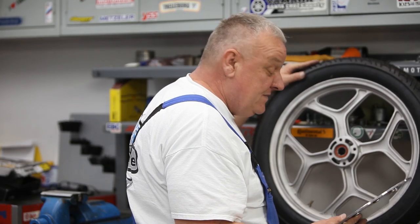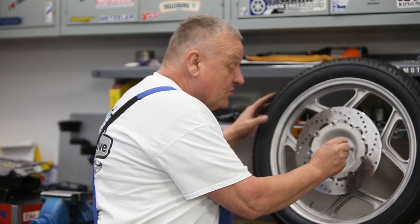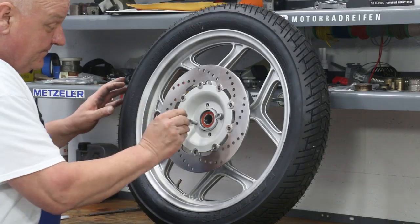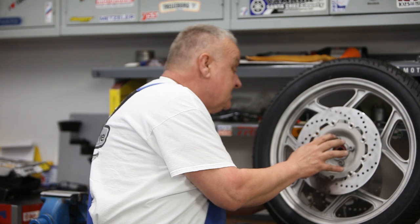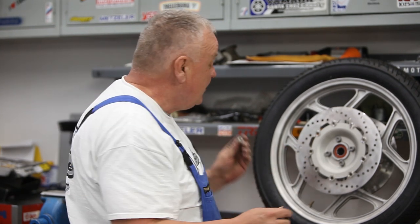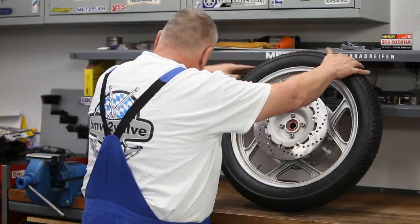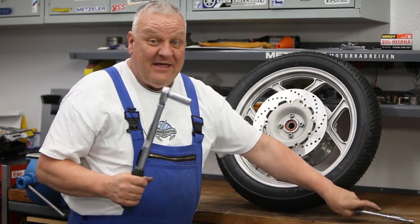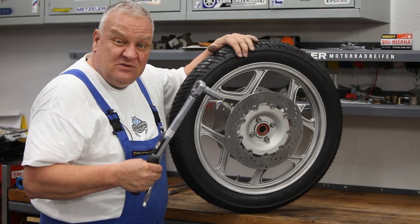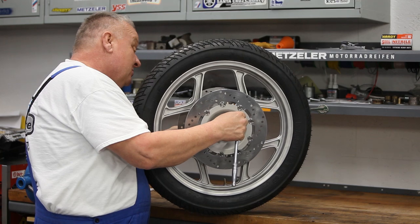We're going to put this one on here. Normally on BMW motorcycles, with probably very few exceptions, they put the nuts on the left-hand side, so we'll put the bolts through the right like so, then the disc inside, and then using new nylocks — these washers go underneath. Get all those started. Once you've got the bolts all snug, go in and torque to spec. Always check your manual for torque specifications.